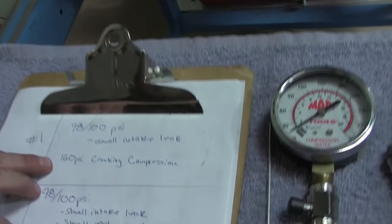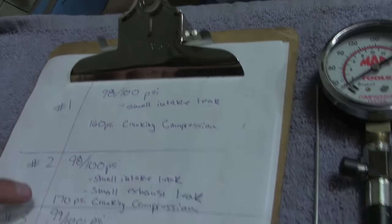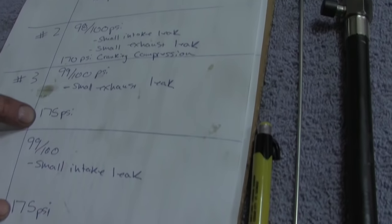We finished our compression test. It came back really decent — cylinder number one had 160 psi, two had 170, and both three and four had 175 psi. 175 psi is getting on the verge of not being able to run 91 octane in a daily driver bug, especially in a hotter climate over 90 degrees. However, this customer is putting this in a trike that weighs about 1200 pounds, so he won't be making a lot of heat and it's going to be wide open — he should be able to run 91 octane.